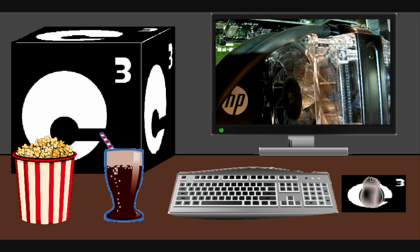And let's say, for example, with closed-loop water cooling systems like what's in this HP computer, I'd imagine this thing might have been manufactured by Corsair or whoever makes them for Corsair, one of those manufacturers. Just from looking at it, I can see that the radiator is an aluminum radiator, and I'm pretty sure that on top of that CPU is a copper water block. So you're mixing metals, which requires a special coolant in the system with anti-corrosive agents in it. In many cases, that can be antifreeze, like ethylene glycol, such as in your car.